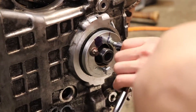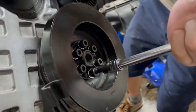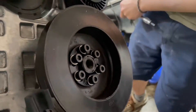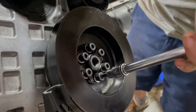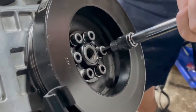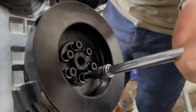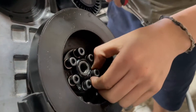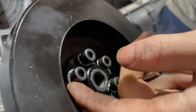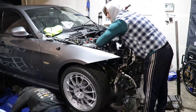Alright, time to reassemble the motor. This is VTT's spline lock with their crank bolt capture, which is quote-unquote designed to be used together. Now we're having to make new threads for this piece of equipment. Everything has been started by hand — they're not cross-threaded or anything. There's still a gap under that and it's tight — the washer still is. At least it came all the way out that time.